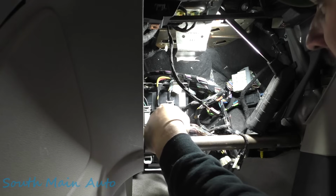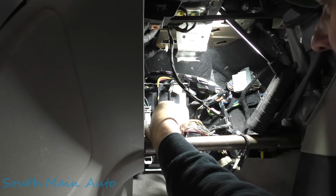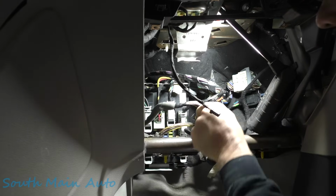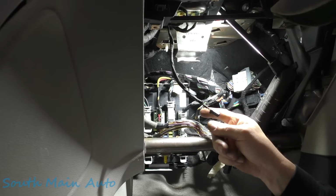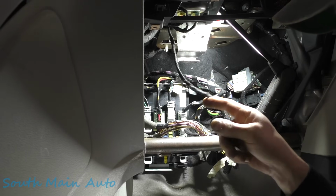I can see somebody's really done the hokey pokey here. Lots of wire poking. Must be they're on the same color wire, because here's a green and violet with a bunch of holes poked in it. Lots of wires here have been poked. So we'll find out which connector we're supposed to be looking for, and then we'll simply ground the wire in here with our test light. And if that relay turns on, we know our wire's intact.